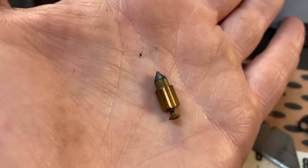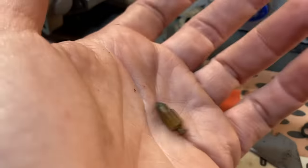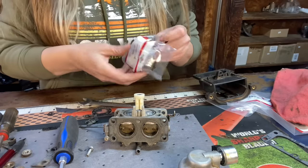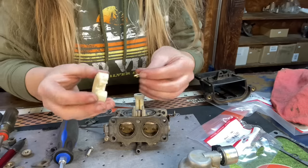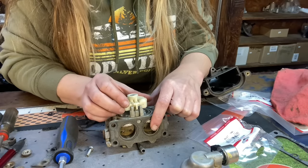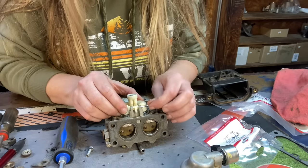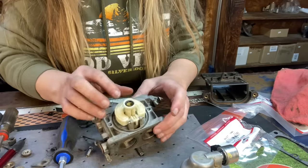All right. With further inspection, I'm not really happy with the tip of this needle, so I'm going to try to save the customer a few dollars, but I'm going to go ahead and replace that too. All right, break out a new needle here. And I will have part numbers for everything in the description box below. We're going to put it back into the carburetor and slide our lever rod back in. Center that.